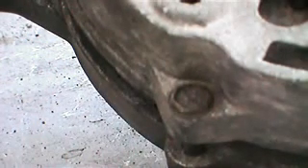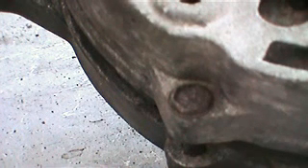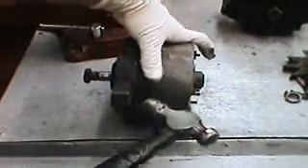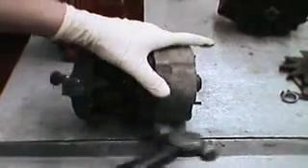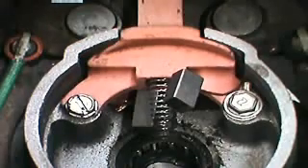Underneath the fan is a thin spacer. There you see the head of the 5/16 bolt that's holding it together — there are three of them that need to be removed. Hold on to the back half with one hand and tap the front half off. Down inside you'll see the two brushes and the two springs. The two springs come right out. The brushes will have to stay in until you take those two quarter-inch head screws out to remove the brush holder.